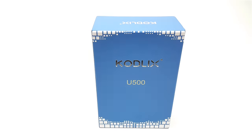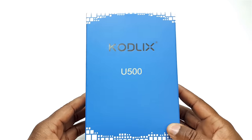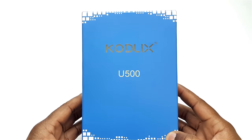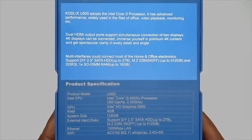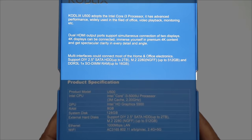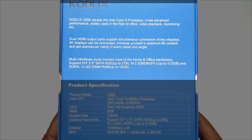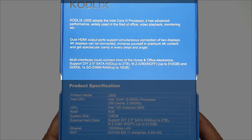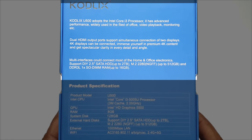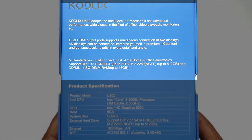So to get started, we have the box that it's packaged and shipped in. It's a very strong box with the model printed nicely to the front here. All the specs and certifications are printed below. Let's see what it says. In the description it says that this mini PC runs on the Intel Core i3 processor, it has dual HDMI outputs for dual monitor display, and it has a SATA expansion bay with a capacity of up to 2 TB, and an M.2 expansion slot with a capacity of up to 512 GB. It also uses DDR3 SODIMM memory, and I'll show all that in a second.